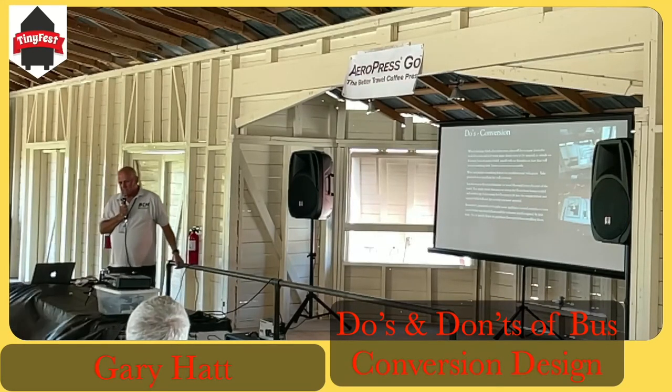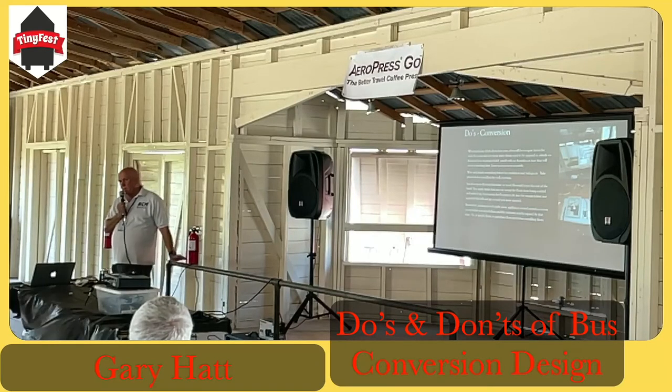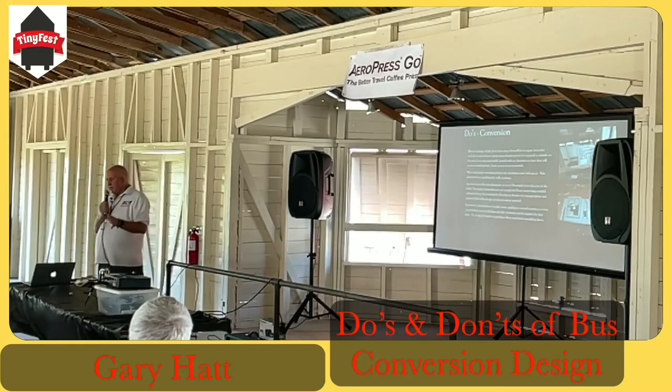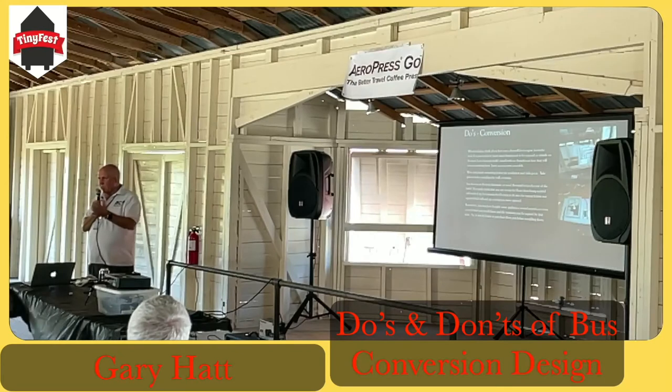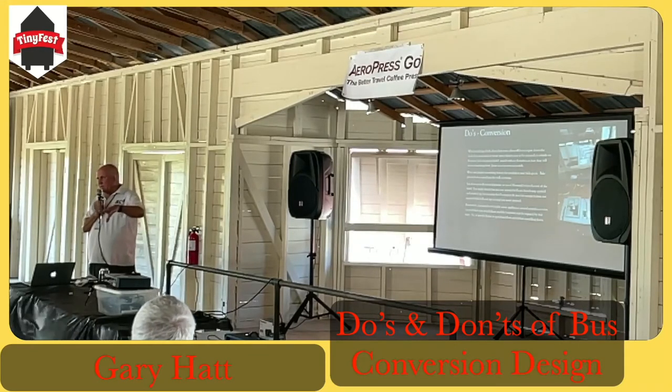And you might think, well, that's going to suck if you have to replace the floor later. Well, you're probably not going to replace the floor for quite a ways down the line. Yeah, it's going to suck. But trying to cut that wood in around the cabinetry and everything later, you're not going to save any wood because you're going to have all these odd cuts and pieces left over. It's not going to save you a whole lot. So there's two schools of thought on that. Put your flooring down and then build your cabinets and everything on top.